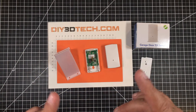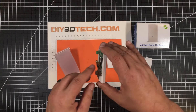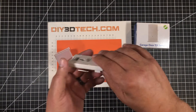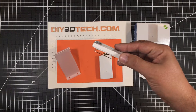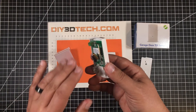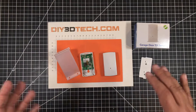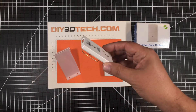What I did is I picked up this Z-Wave tilt switch. The way this works is it's got a small tilt switch in here — this little gold device that sits at an angle. Notice it's turned back a bit because the cover goes on here. There's a small ball bearing in there that rolls back and forth, so as the door goes up it rolls back this way. However, the door pretty much has to be open for this to trigger because of this angle.